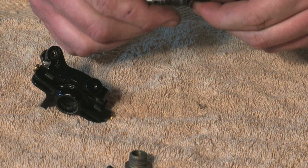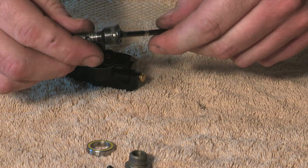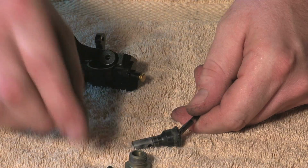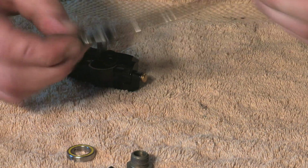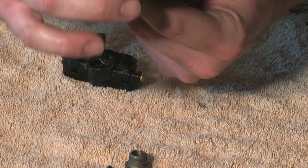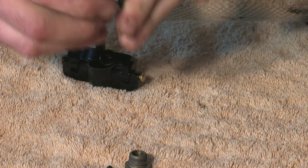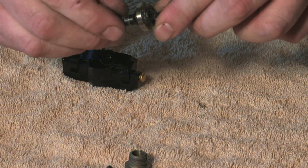We're going to go ahead and replace the CVD with the new bearings. Now, like I said, it's pretty important to go ahead and rebuild your CVDs whenever you install new bearings. Okay, so you can see we've re-greased everything. You want to go ahead and take the bigger bearing and slide it over. And as you can see, sometimes the drive pin can stick out.